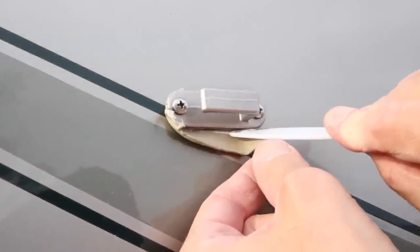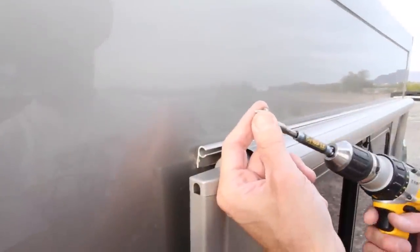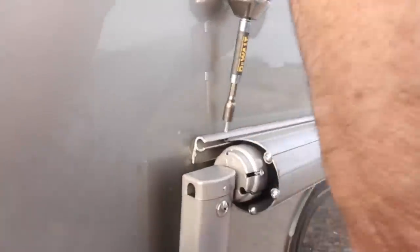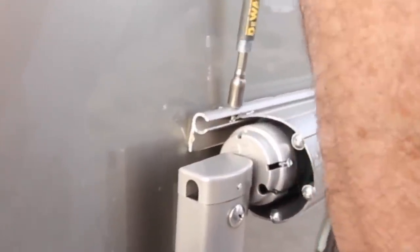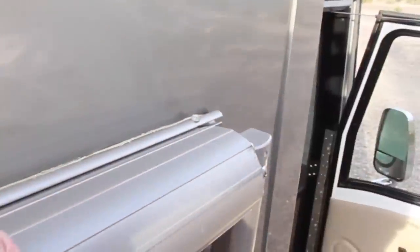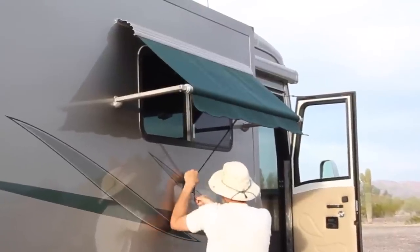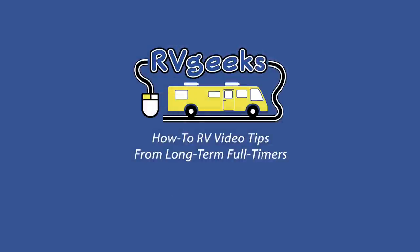Use your plastic knife to remove any excess putty. After reconfirming that the roller tube is centered in the track, install the included self-drilling screws to hold it in place — come straight in from the top, no pre-drilling required. Installing the screws tightly pressed against the ends of the metal wrap or fabric will hold it firmly in place. And that's it — our beautiful new awning is in place.